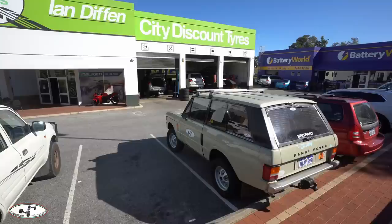The guys at Car Care did a whole lot of other work that has made the vehicle nicer to drive. I can feel some vibrations I couldn't feel before, but that's because we've replaced the engine mounts and the gearbox mounts. We've sorted the brakes — they are now absolutely really good. Still wandering slightly to the right, but that's a bit of oil residue on the pads which will wear off in time.